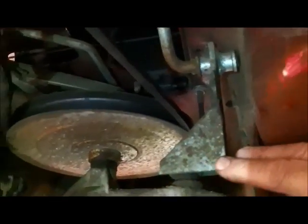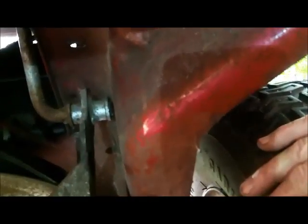Another thing too, when you move the shift lever, see how easy that moves? Not even sure if I'm in the camera because I'm sitting down on the ground. But anyways, when you move that, you move this, see? So, it's not like a snowblower. You're actually changing gears in here. But your so-called clutch is just loosening and tightening the belt. So, this is what I've been reading, and this is how it works. But this will help out somebody maybe that has the same model tractor. Well, I can't do no more on this now until I get an idler wheel for this.